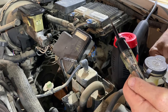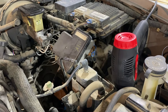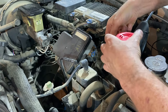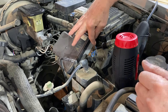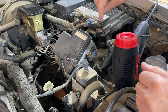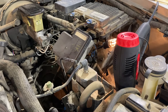I'm finding a little screw up here behind the driver's side headlight, next to the washer fluid fill — that's going to be my ground. Then I'm going to poke the purple wire. It's in the top of the plug that goes into your ABS. I believe there are eight wires total, five on top, and the middle wire is purple — that's the wire I've poked. Now I'm going to turn the ignition key to the on position, not run but on, and depress the brake pedal.